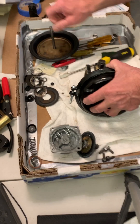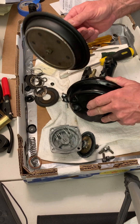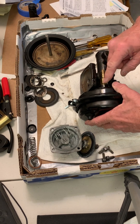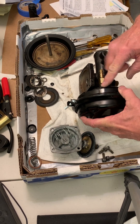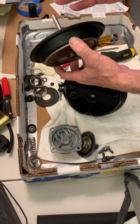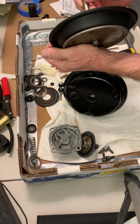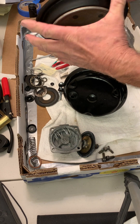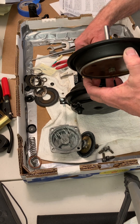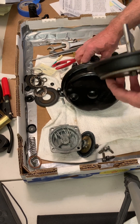So where does the power part come from? The power part is this diaphragm, which is inside this vacuum chamber and separates it into two parts. When you apply vacuum from the engine to here, it goes directly into this side of the vacuum chamber, so this side gets evacuated. If you take all the air out of this side, this whole diaphragm is going to move forward, and when that happens it's going to push the piston inside here and put the brakes on.